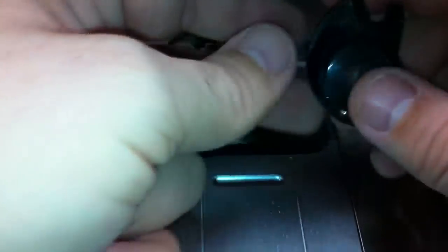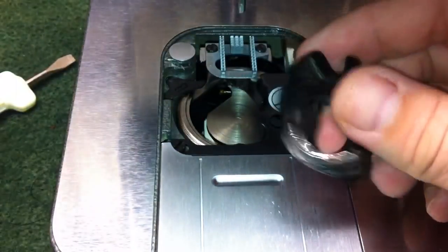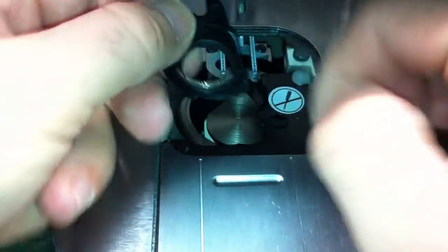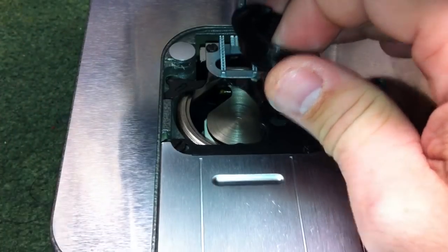So it should just fall in little small increments — you should be able to jiggle it a little bit and have it fall down, but still hold its own weight. This tension seems to be about accurate. We're going to go ahead and remove the bobbin and reinstall the case back inside the machine, just reversing the process.